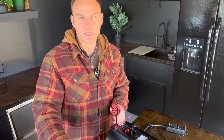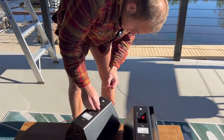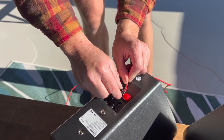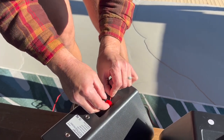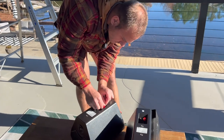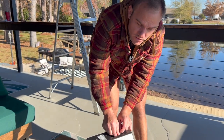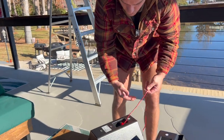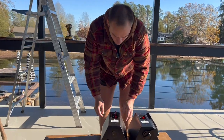The rest of the speaker cable connects to your other speaker. The speaker cable they provide is 16 feet long, which is the maximum distance between the two speakers. They recommend placing them eight feet apart and just above eye level. If the wire is too long, you can just cut it to your needed length and clean the ends. If the wire is too short, I'd recommend buying a specific speaker wire of the right length rather than extending this one, since you want as few connections as possible.